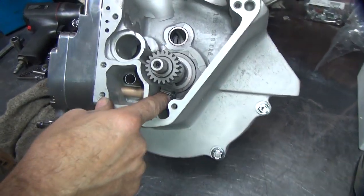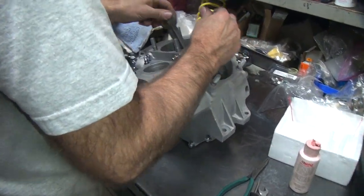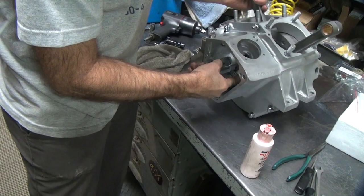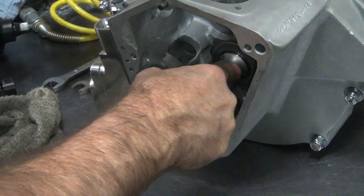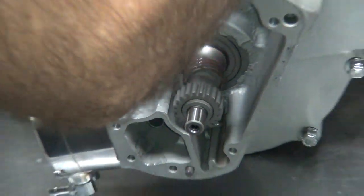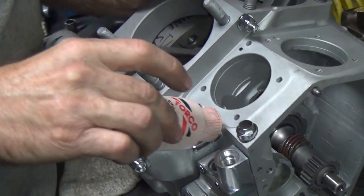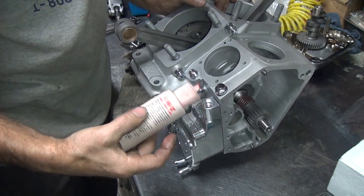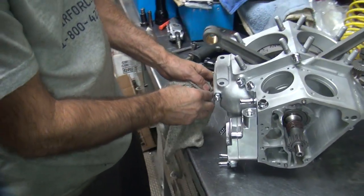That's why the key can come out, especially when you get a big gap like that in there — which is why it's not good to have those. See, there's your keyway right there. If that clip has a gap in it like you usually get, and the key is like that, the key can come out. And it does happen — even on one of my own bikes. It rotates really good but it's a little bit stiff. Put a little bit of oil on the teeth here. That frees it up a little bit. Still got a little drag on it, not too bad.